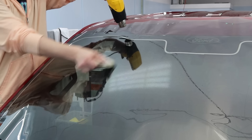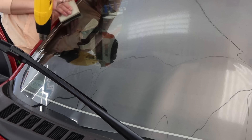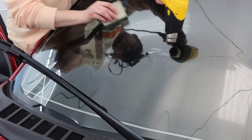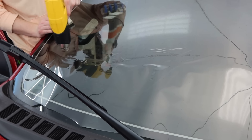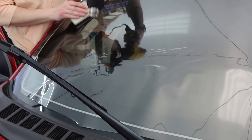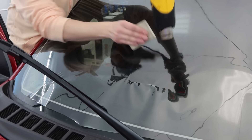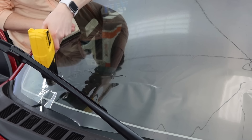We're not actually going to pull shrink at all along the bottom. We're going to shrink the bottom like we do most any back window or most simple windshields. There's a decent amount of film here, but it lays down pretty quick and smooth. For this one we're using GeoShield's Pro Classic film — looks real similar to the ceramic that we shrunk in the past couple of videos. Nothing crazy. You put the heat on and it starts just laying smooth, and then we take the card and press it all down.